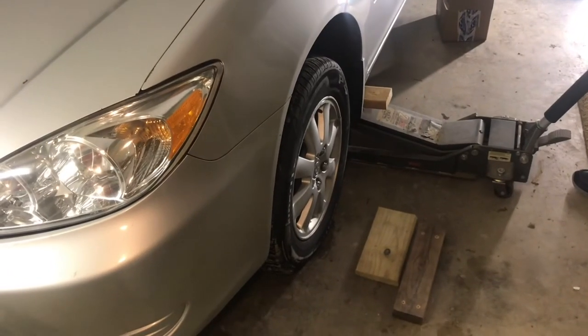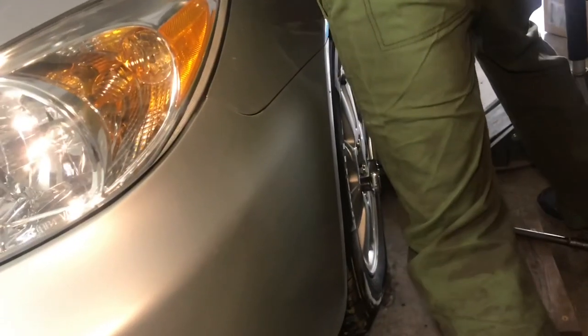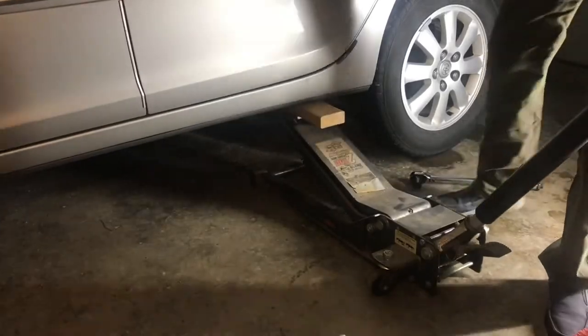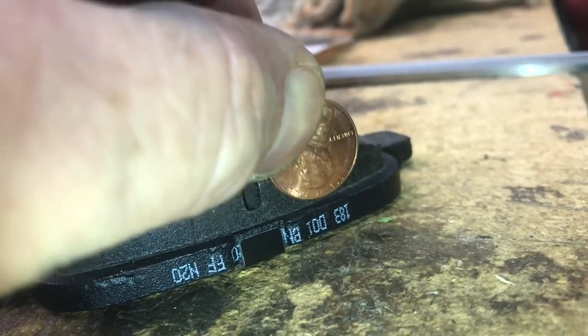Make sure when you put these wheels back on, you want to torque down the lug nuts to the right torque. Then drive the car and re-torque it, especially if the rims are aluminum — as you drive, the lug nuts can loosen up. So if you did want to check your brake pads to see if you have enough pad left, now you'll know what to look for. I appreciate your time and thanks for watching.